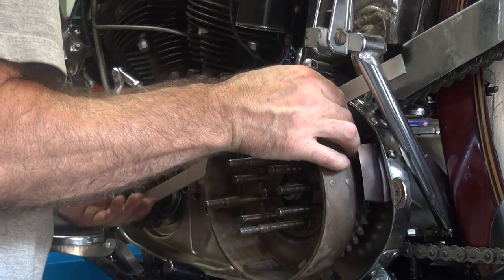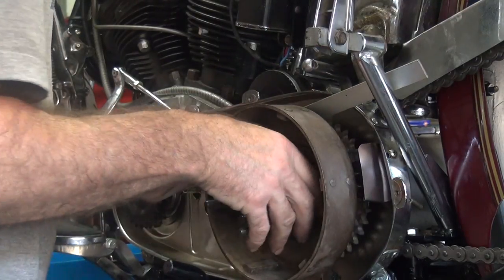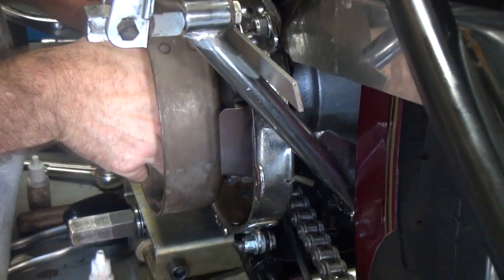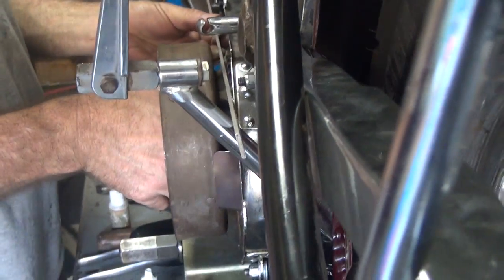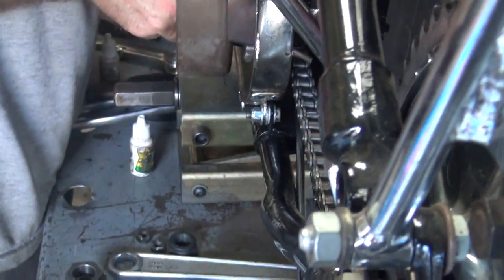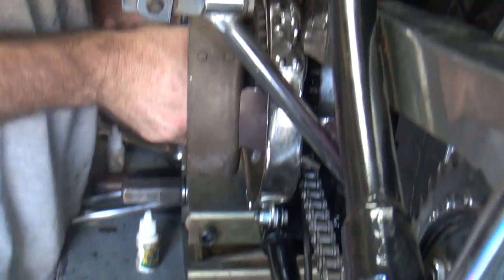I'm going to check our alignment here and see what I think we have. Drop your grip thing on the floor. I'm looking at the offset of the primary chain relative to the vehicle. And if you notice, we're only off by about a half inch. That's not too good. I'm thinking the tranny needs to be adjusted somewhat.